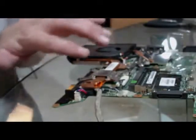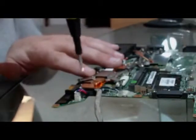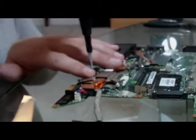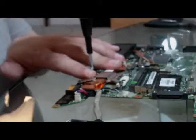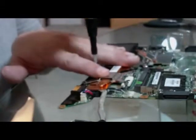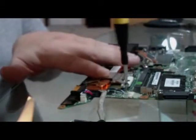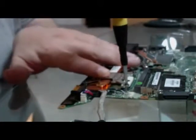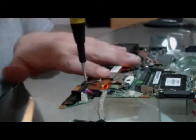I'm just going to take my fingers and lightly hold this down. This is not even a single pound of pressure, and I'm just lining up the screws and tightening down in the order. Number 2 is across from number 1. Number 3.